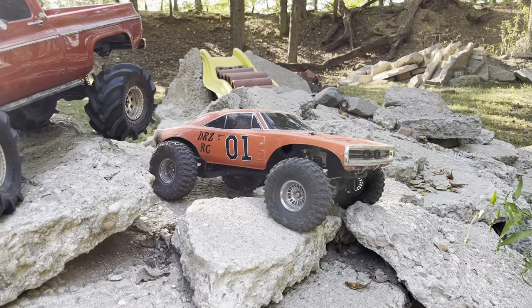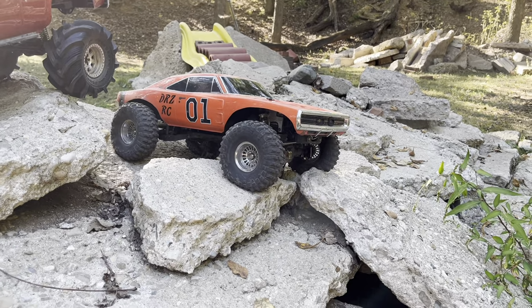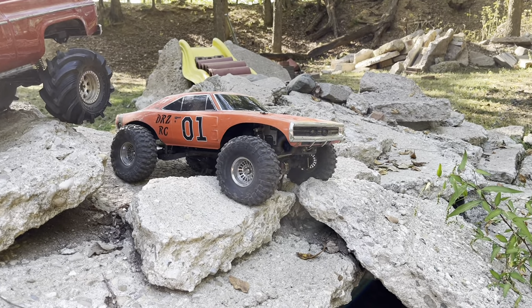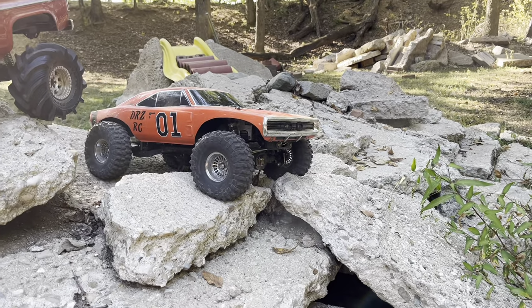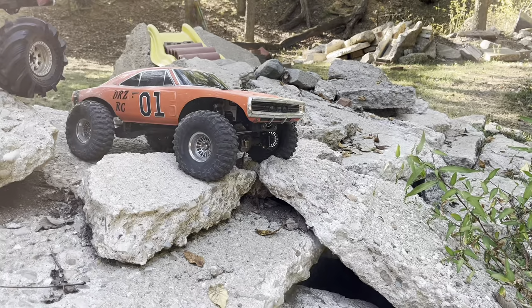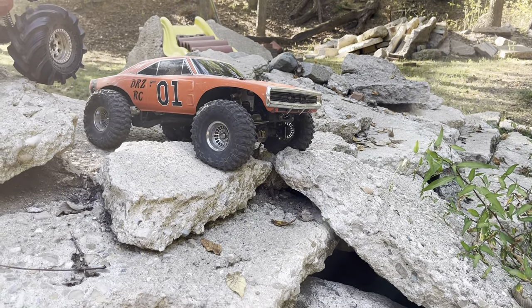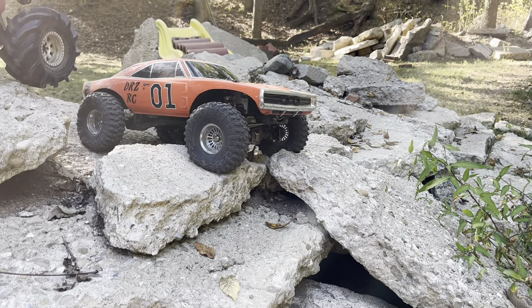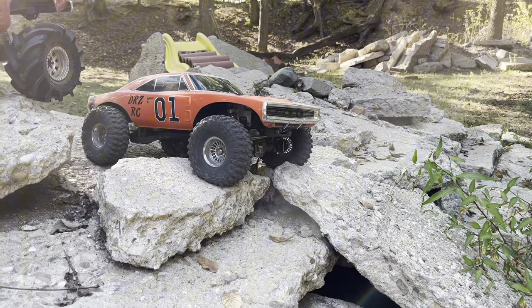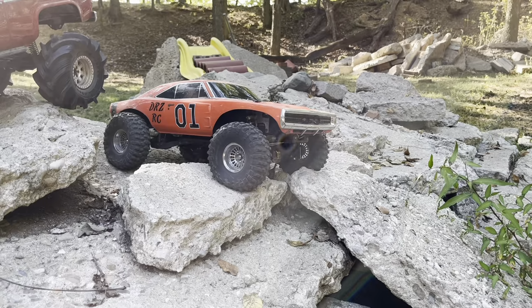Been having this thought all afternoon, looking at this thing after putting it back together: is the General Lee again. What do y'all think about doing a pre-runner build with this? Get rid of that straight axle in the front, keep the trailing arm, straight axle, sway bar, the whole nine in the rear. Maybe get the twin I-beam or just the IFS, I don't know. But make this thing two-wheel drive, pre-runner style.